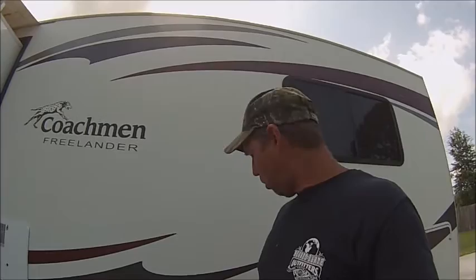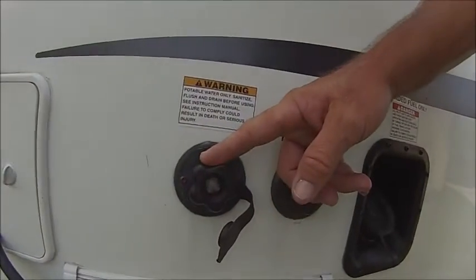It's not that serious, guys. There are times to be serious, but that's not one of them. You don't have to be right on the money with that. What I do is I eyeball it, just like a cook — I put approximately three quarters of a cup of bleach to my entire tank, which I think is roughly 50 to 55 gallons. I've been doing this for a long time, it's never given me a problem. Hook it directly up to your port here after adding the bleach to your hose, turn the water on, and you've just injected bleach right into your system.